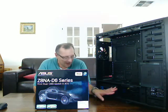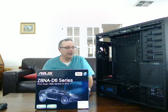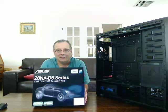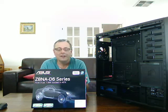And then because you're using those kind of enclosures, you can't use all the usual power supplies that go in a normal computer case that you can pick up off the internet easily enough. The cases themselves also are a different format because they use a different shape motherboard. So once I stumbled across this ATX motherboard, which would actually allow me to use it for a server, I thought this could be the way forward for me.